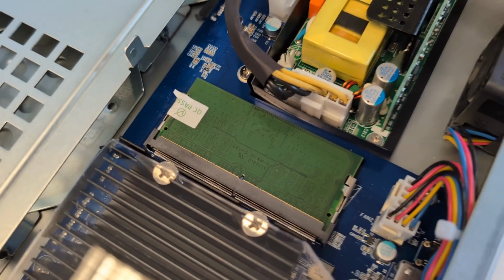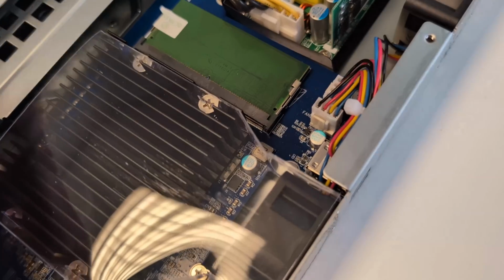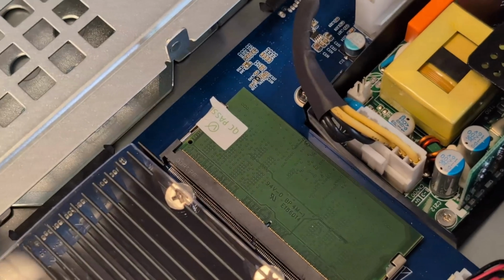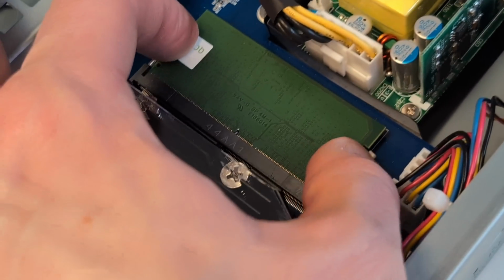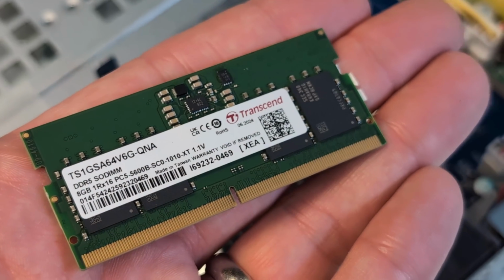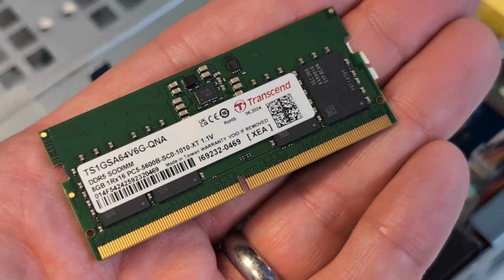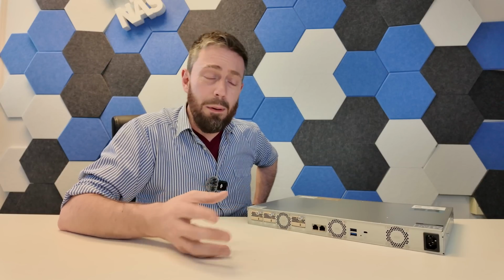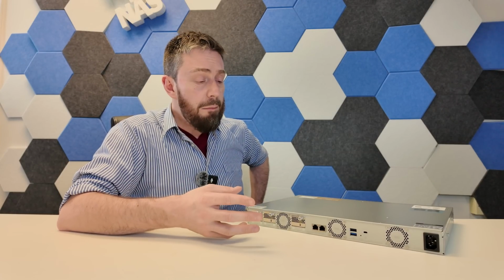This next point concerns the memory. Number 1, it's not ECC memory. Now, I'm prepared to go a little easy because, at this scope, I'm not sure everyone would take advantage of ECC memory, but I will say, again, for $1,000, for a rack mount solution running on an Intel Atom processor, it doesn't have ECC memory. It's got on-die ECC, but not real, true ECC memory in there.